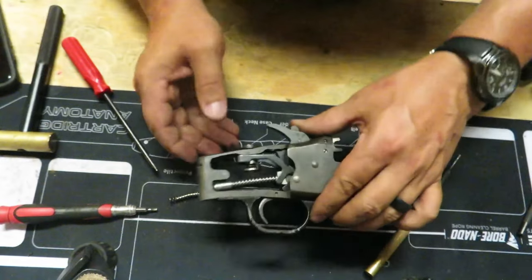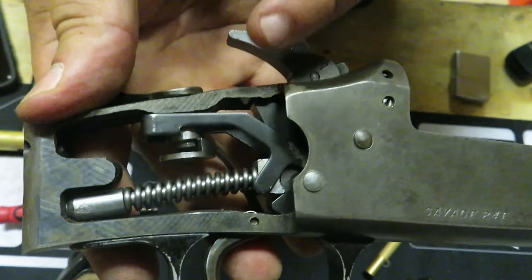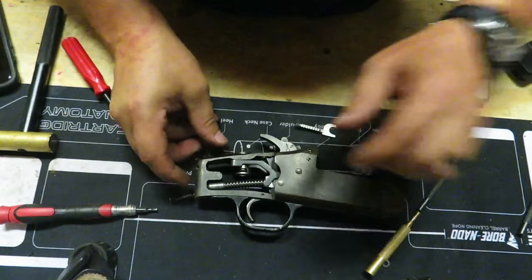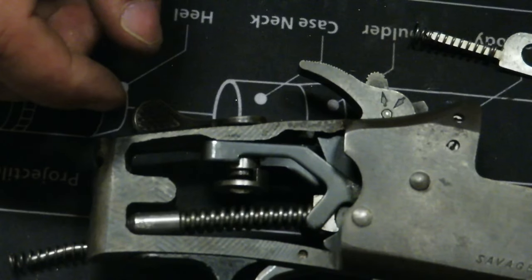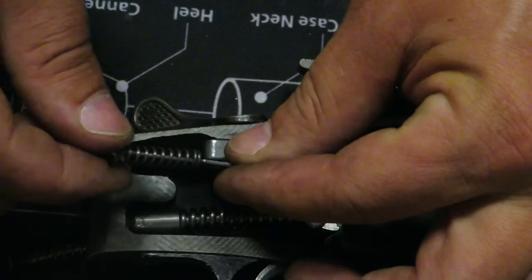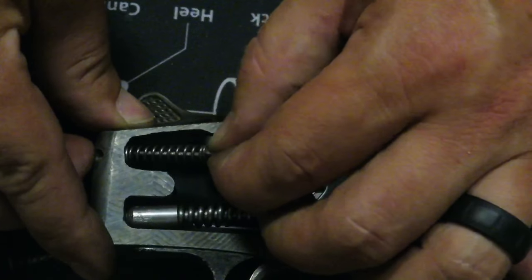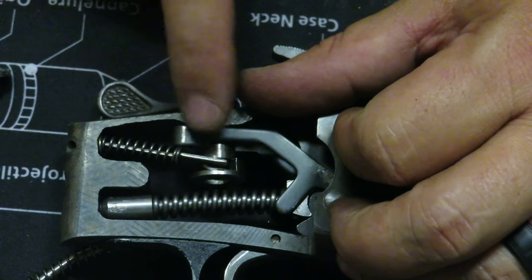Bring this piece just almost to the actual lever — you can see there's a little bit of a gap, that's the way I want it. This is going to go in just like this — put that in there, but you've got to line this hole up first with this pin. Put that piece in there and then kind of push back on it to get it to go down. If you try to do that before you put that screw in there, there's no way you're going to get it past this big piece of the coupler.